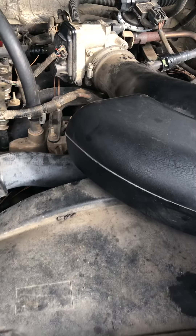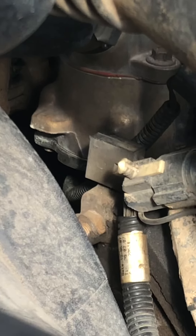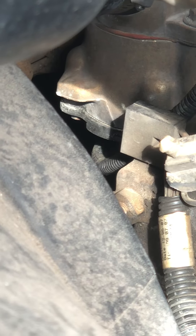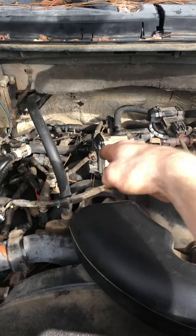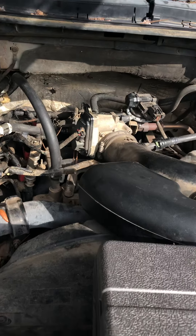I just want to make sure everything works before I change the manifold out because I'm leaking coolant. Right there is where I had a lot of leakage, so I got some red RTV up in that joint. But on the bottom it's a sandwich — metal, plastic in the middle, metal on the bottom — and that's what cracks. Even though I'm sealed up top, the coolant must be cracking through, working its way to the back, and going over the transmission. It looks like transmission fluid but it's actually coolant.